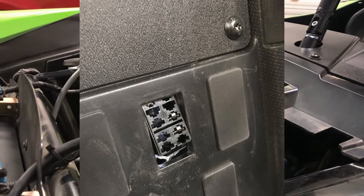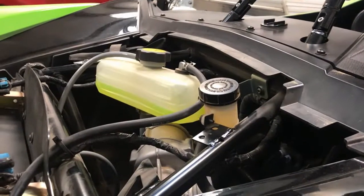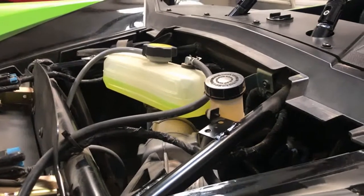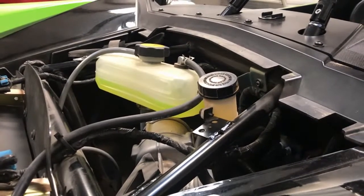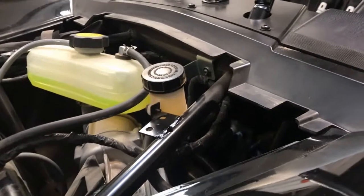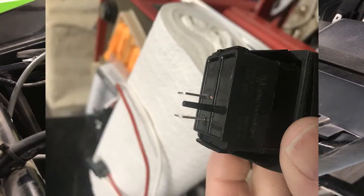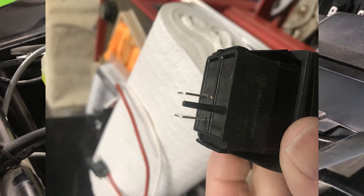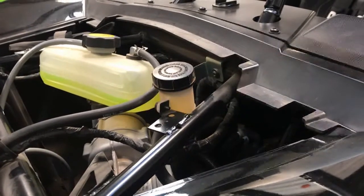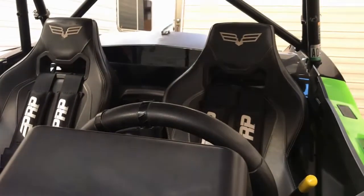If you look at the standard Carling switch book, you'll see the standard pinout. This follows many of the Chinese copies and others, but it's a very standard arrangement. So if you plug a switch into the dash, the simplest one I'll put in the description below as well, is a Wildcat switch. I'll show you a picture on the dash, and that just connects pin 2 to pin 3, which feeds power then back to the B1, B2, or B3 fuse between the seats.